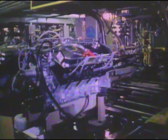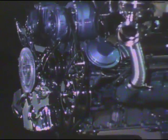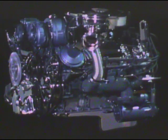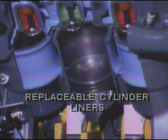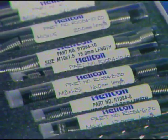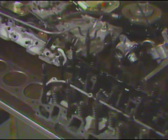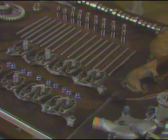Like any other engine, it will require a certain amount of maintenance. When viewing this engine from a service perspective, you'll begin to notice that there are certain design characteristics which will require service procedures different from those used on other gasoline-fueled engines. For instance, there are replaceable cast iron cylinder liner assemblies and the new steel oil pan that is made corrosion resistant with zinc dichromate, which gives it a unique appearance. Also, the bolt holes are repairable with the helicoil thread repair kit. Let's begin by taking a look at the HT4100 DFI engine from a structural point of view and examine the various parts as well as service procedures required.